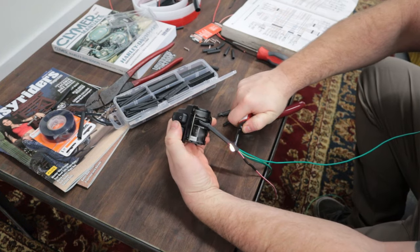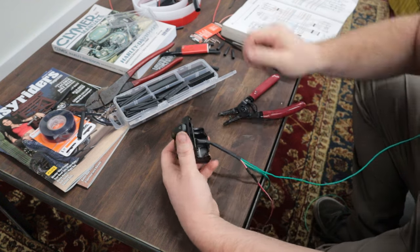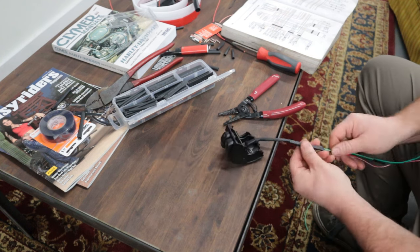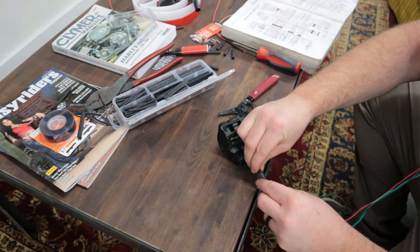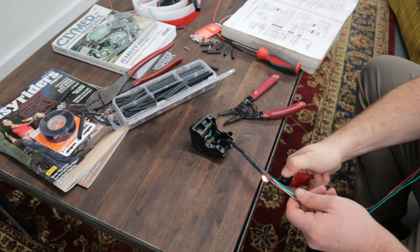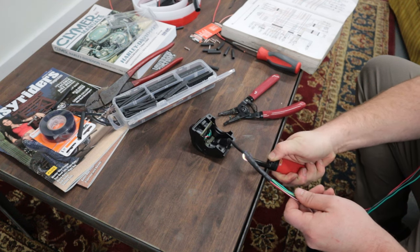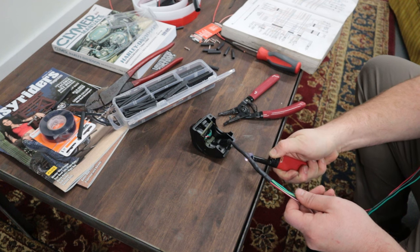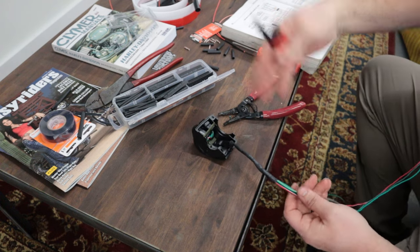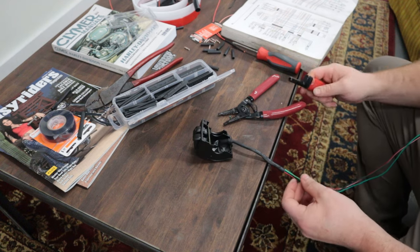So we're going to melt the first piece of shrink tubing. This is important to protect the wires when we pull them through the bars. Then we'll take a second piece and slightly overlap it by maybe a quarter inch on that previous piece we just did, and then seal it. And you're just going to do that all the way down till we have these wires sheathed the way we need them. Or if you have a roll of shrink tubing, you can just do it all at one time. I don't have that. I have this kit. So on to the time lapse for you guys.